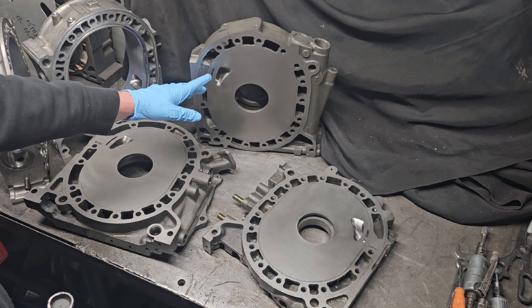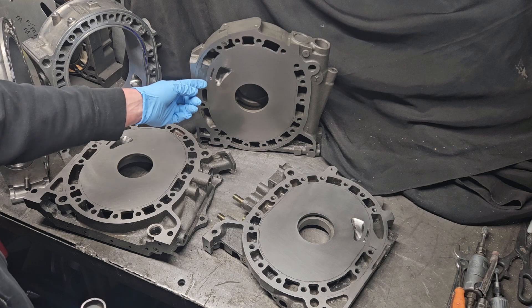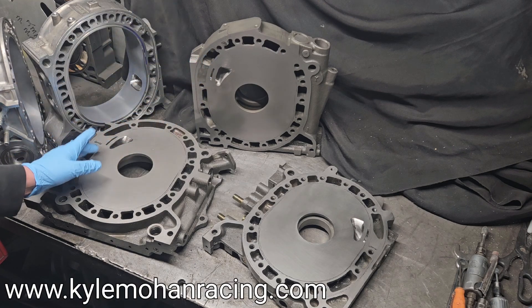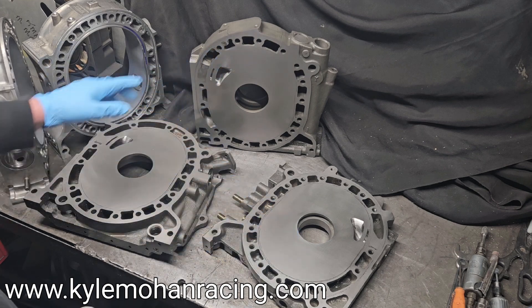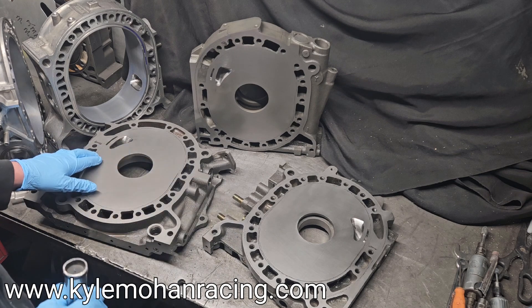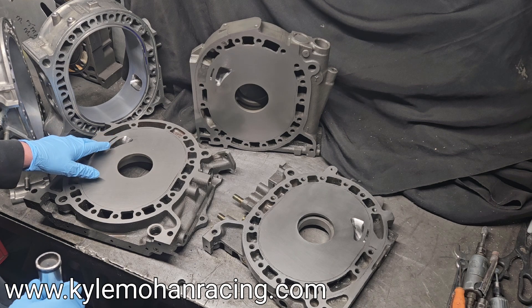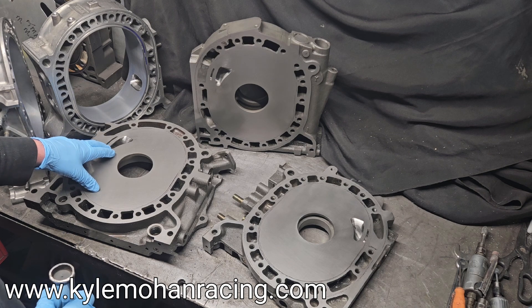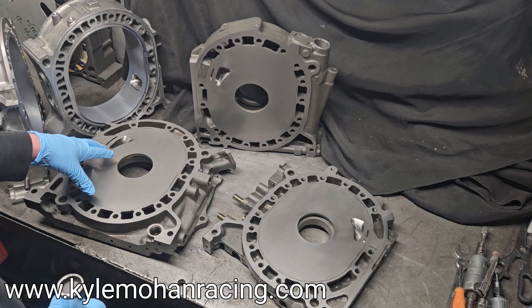So, we kept our primary bridge slightly smaller, limiting its duration and limiting its volume, but still benefiting from a very early intake port timing and matching that up with our secondary ports, but not extending it quite as far. The street port itself is matched on all four plates, so our closing timing is all the same, but we're basically staggering the volume of our bridge intake opening so we get the best performance possible. We're trying to not lose as much bottom end as a traditional bridge port does, but we're still trying to bring in ample volume for a naturally aspirated configuration. So, the customer gets a mean sound, great performance, good reliability, and they can wrap it all the way home.